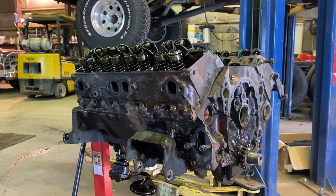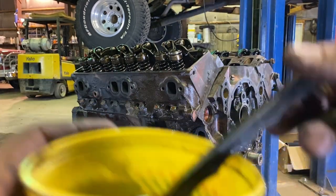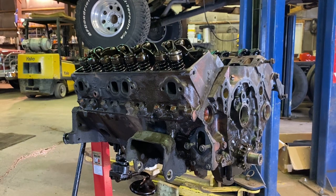Sorry I didn't record or do a time lapse of pulling the motor out — I was kind of busy, Dad was helping me do it. But now I got the motor over here. I'm going to use my cup of gas and wire brush trick and scrub it all down, get it as clean as I can, take the motor mounts off, get it really clean, and prep all the surfaces so I can get it ready for the cam and everything else I got coming for it.